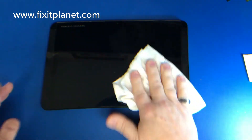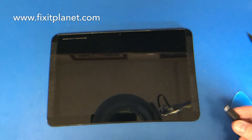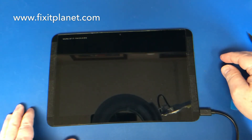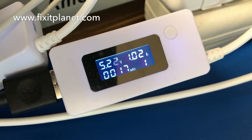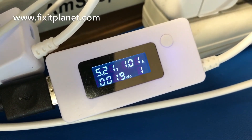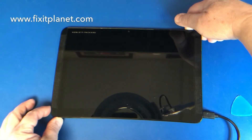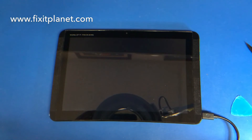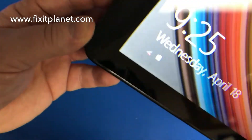This one was really nasty — a lot of stuff on there, some of it didn't want to come off. I noticed when I plugged this thing in that there's no charging light indicator and nothing comes up on the screen with a battery icon. We have a meter, so we'll take a look: it's at about one amp and it is taking a charge, right where we should be when the tablet is off. It sat on the charger for a little while and now we're going to turn it on. I don't have a password to get in here, but you can see that it does show it's plugged in.